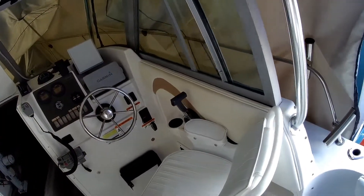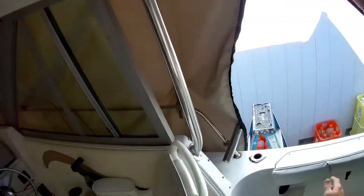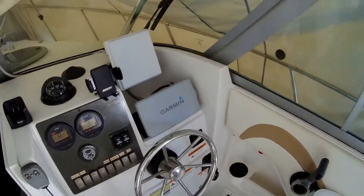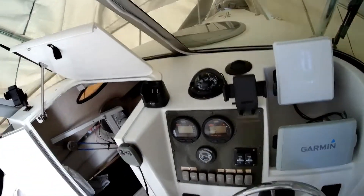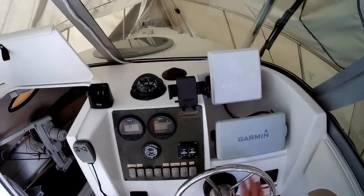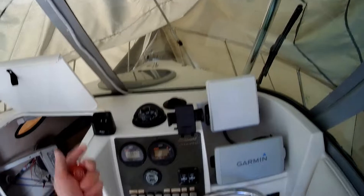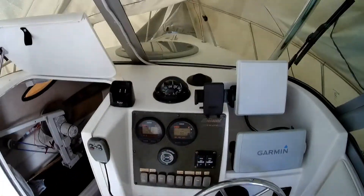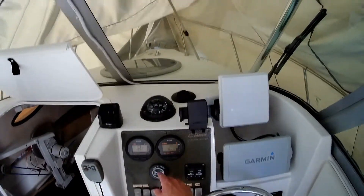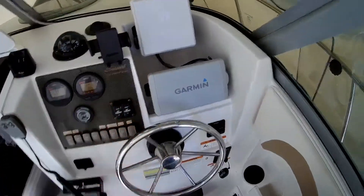What's cool is if you have someone else with you and the motor shuts off because I fell overboard with the fob — after about 10 seconds, they can come in, turn the ignition off, and start the motor without the fob to come pick me up. There's also an override: if I went out fishing and left the fob at home, I can hold the override button down for 10 seconds and it'll override the system so I can still start the engine.